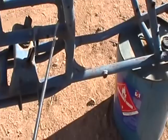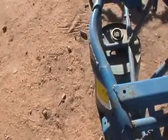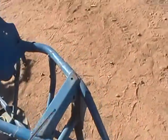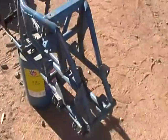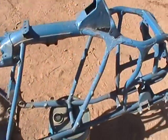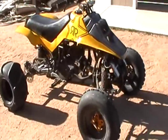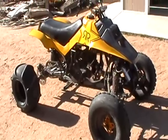You can also put one right in here. There's really not that much load on the upper arms. All the load path comes through the spindle, from the tire, wheel hub, spindle, lower ball joint, A-arm, and then it's transmitted up to the shock mount. But the factory bracing up here is excellent. So that's basically it. Even though it's an 87 frame, the front of it is just identical pretty much, other than the steering stops, to an 88 to 90. I'm pretty proud of Sonny — he just did a hell of a job on this bike. I'm real partial to the 250-500 hybrids; I had one for years and years called Pammy. Anyways, hope you folks enjoy the video — we will talk to you soon. Bye.